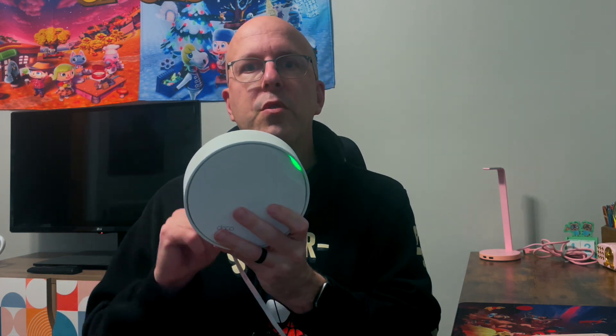From a physical standpoint, there's a couple of features that you get. Right off the bat, you get a wall plate or a ceiling plate that has all the screw mounts in it so that you can hang it wherever you need to in your home. The system itself stands about three inches tall, and there are two RJ45 2.5 gigabit network plugs on the back. One plug is power over ethernet — these things power themselves over the ethernet cable, so there's no need to run a power plug, which makes it really easy to hang on the ceiling or wall.